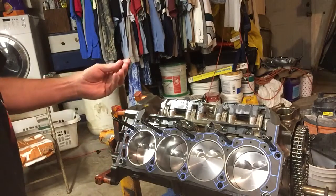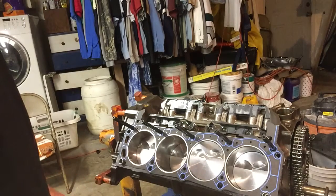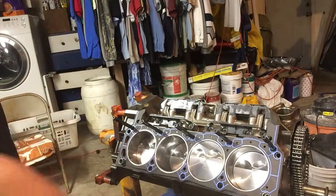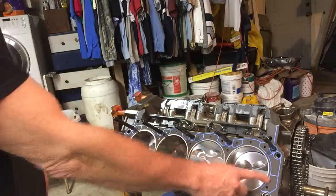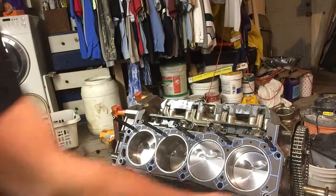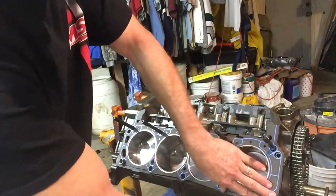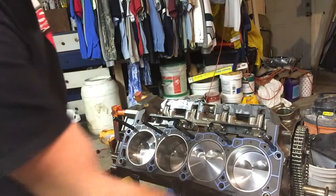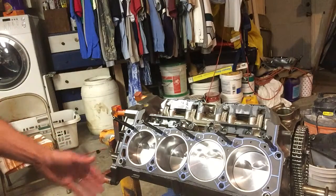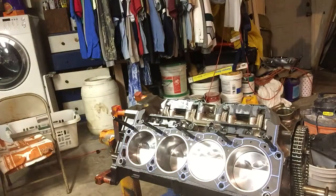It's also to give a slight bump on compression over a stock block. One thing that strikes me when I put these on, there's a label up here that does say front. I know it goes to the front. And just for reference, you'll also note that there'll be a square tab sticking out the front here at the bottom, which indicates that the gasket's installed. The back one you'll see is rounded off, does not protrude. It's intentional for inspection purposes, to see the gaskets there.